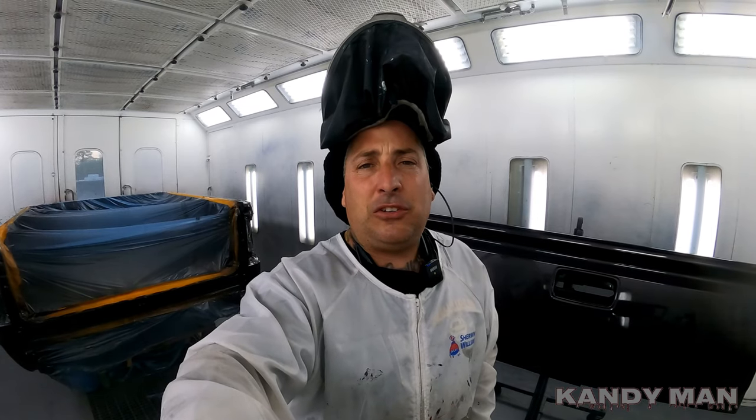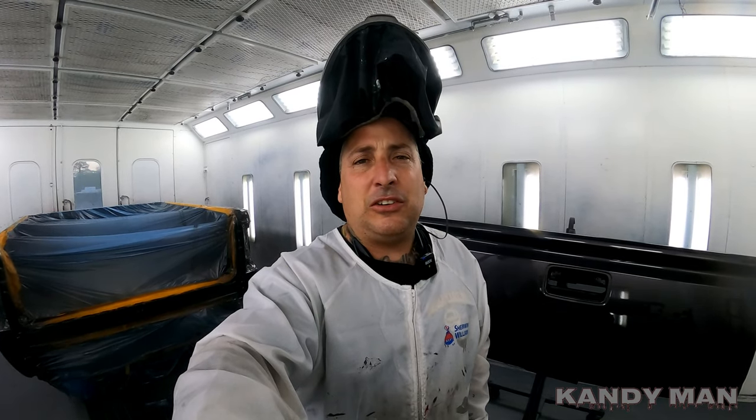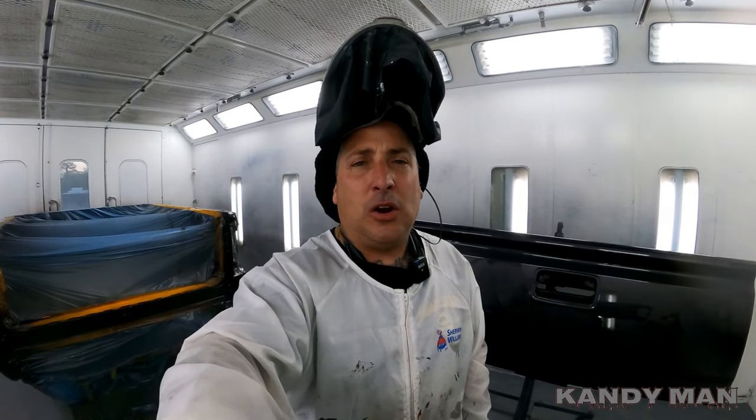So you're set to the hardener and the clear. So make sure you get something that you can get around the car with, that doesn't set up too quick. But don't get something that stays open too long and attracts a lot of dirt. So I just thought I'd do this video on different things.